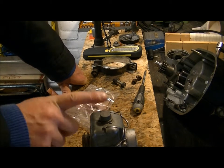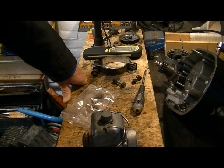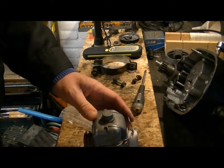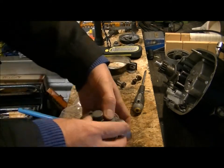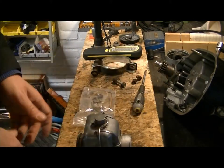But I'd still like to try to use the Bing, even for that 10% of gas savings. It's probably the case that this thing has worn out in just 30,000 kilometers — that's less than 20,000 miles — and in my opinion that's almost outrageous. My first MZ I drove 50,000 kilometers before it went down in an accident; it had a BVF and that never failed. I was also surprised to find how worn the needlejet bearing was, probably from the needle bouncing around in its seating.